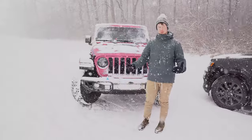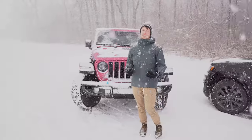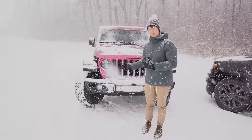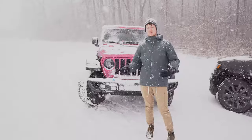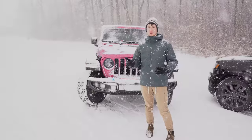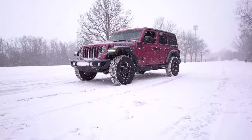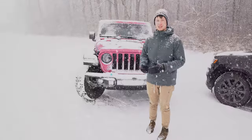One cool aspect about full-time four-wheel drive — and why you get it in every 4XE and also the 392, which I don't even think will let you put it in two-wheel drive — is that with full-time four-wheel drive, they feel comfortable with you driving it on asphalt 24/7. It also lets them distribute the insane amounts of torque these Jeeps can put out between the front and rear axles. On the 4XE, you won't get all of the engine and battery power delivered to the driveline unless you're in full-time four-wheel drive, because they're worried about too much torque to the rear axle and possibly damaging it. That's why the Rubicon 392 won't go into two-wheel drive. Put a 4XE in full-time four-wheel drive, do a launch versus two-wheel drive, and you'll notice the engine actually delivers more power because of the full-time four-wheel drive.